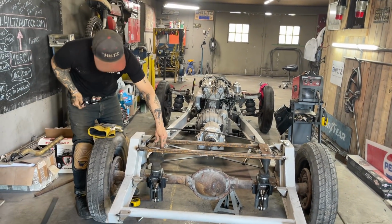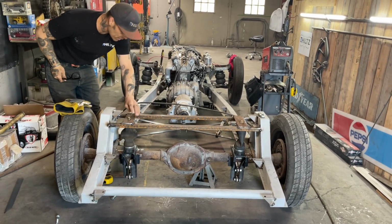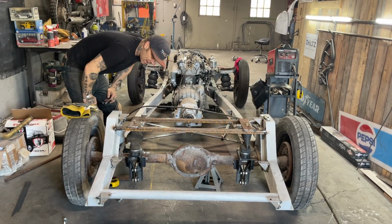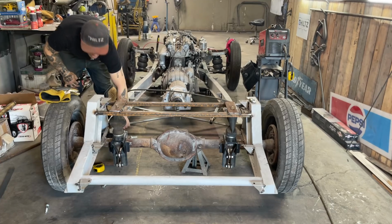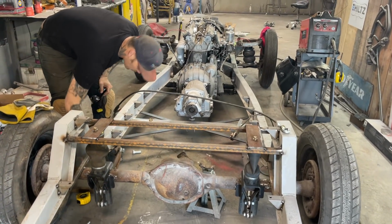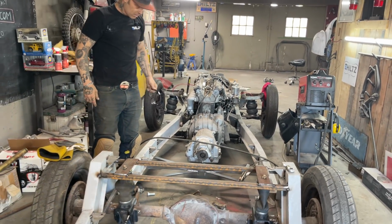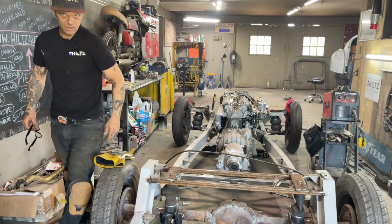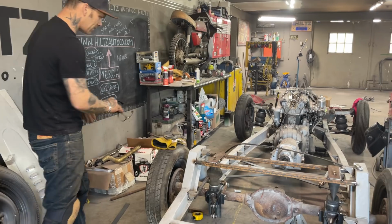Bag is going to sit here. Airline's going to come underneath the bottom. It shouldn't bend that quarter plate, that's like an inch away from that, shouldn't bend that. I can't see that to put that air right up. This hairpin is going to be connected down here. We'll gusset this piece onto the frame on both sides, so that's nice and strong. We do not want that going anywhere, not even close. Basically, that's the air ride system with the brackets in place.